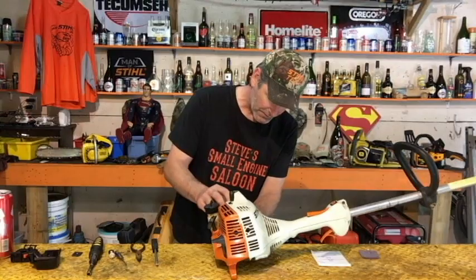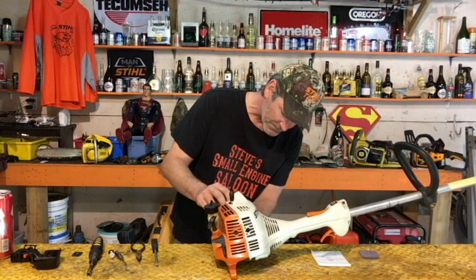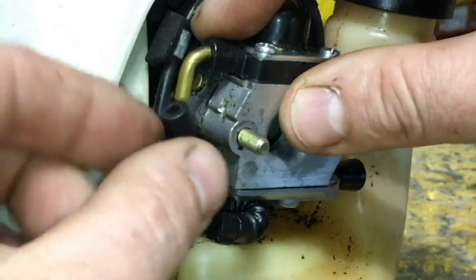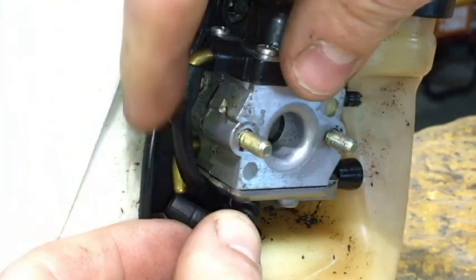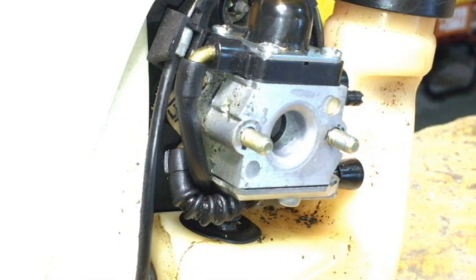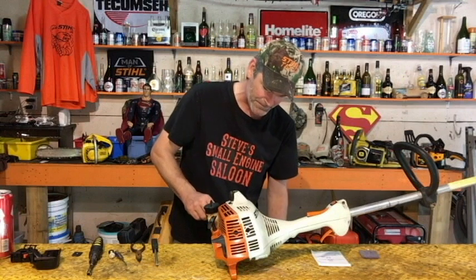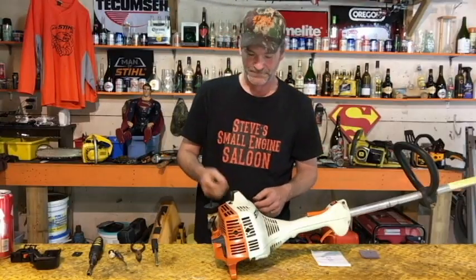this is how these fuel lines are from the factory. I'll show you as clear as I can here. You take that longest fuel line out, the one that was closest to the engine, and you put that on the top connector. The next one kind of wraps around it like this. I'm going to try to get a video here as clear as I can. I hope that's clear. That one goes on like that. It kind of loops around that little accordion style lower line, wraps around that one like that. That's the way they come from the factory. That's the way you should put it back together. That's the way no lines are going to actually get pinched and kinked in there.